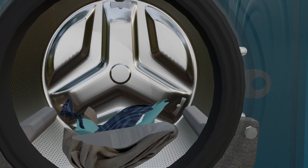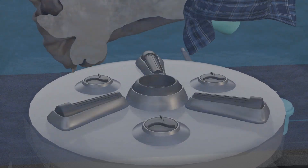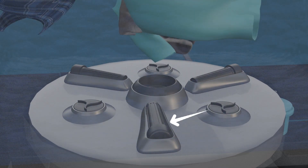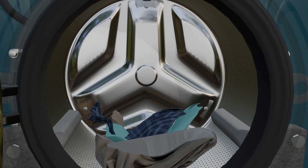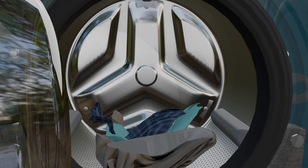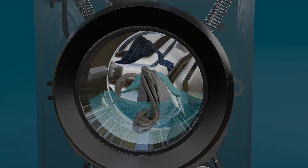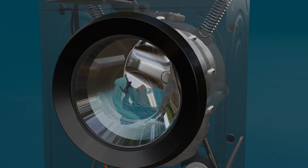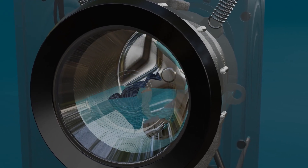Now the machine starts operating. The inner drum's design is quite different from that of a top-load pulsator. The pulsator rotates clothes vertically on its own but doesn't apply enough pressure, which is why it includes rollers that push against the clothes in water — though these rollers also hit the fabric harshly. A front-load machine has none of these components; its drum has a simpler design with only small raised patterns on its surface. As the drum rotates, its main purpose is to lift the clothes upwards and then let them fall back down under gravity into the water below. This gentle action is called the tumbling effect, and it's how front-load machines clean efficiently — using 40–60% less water compared to top-load models.